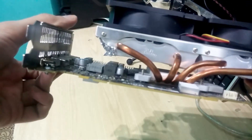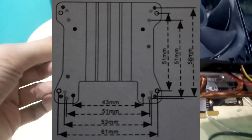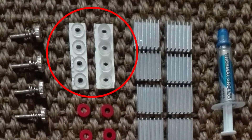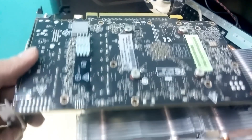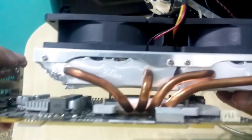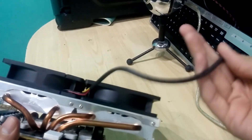Now for the most important part: applying the GPU cooler on the GPU chip itself. You have to use the 53mm screw holes on the VGA cooler for the RX 480. This cooler comes with small rubber round insulators that go between the VGA cooler and the screw holes. There are two types — thick and thin. If you use the thick ones, the cooler won't contact the GPU die; if you use the thin ones, it will bend the PCB.